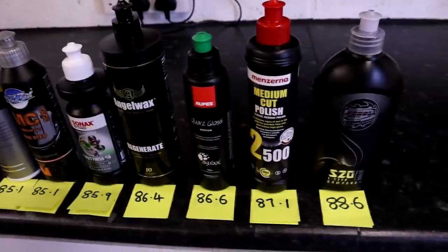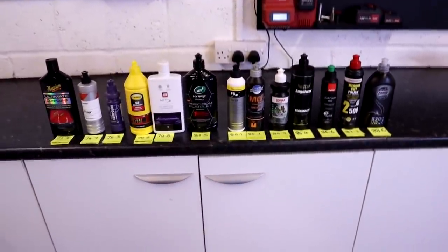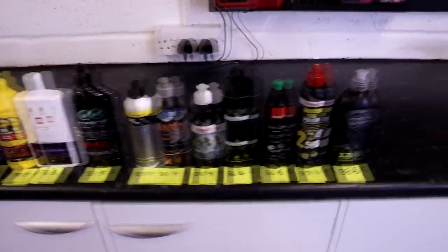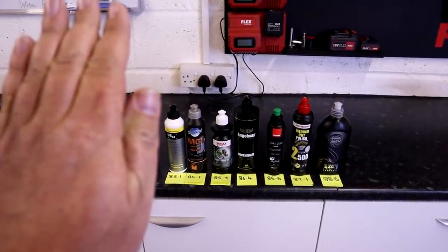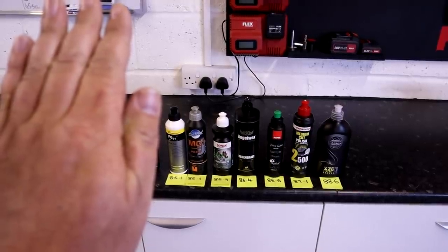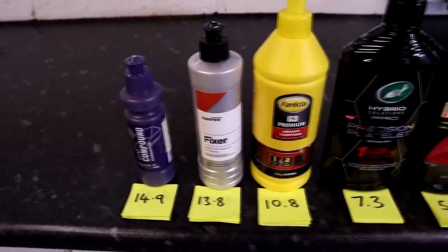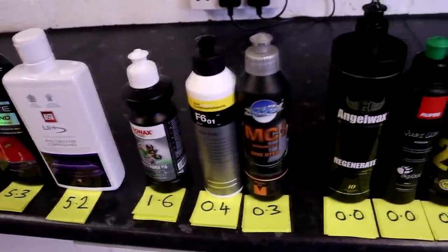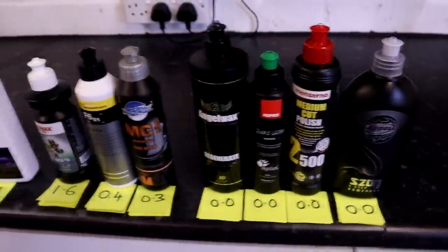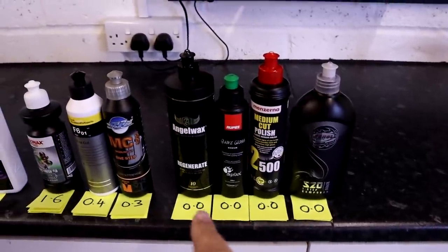Results can always vary, and it's important to say these products perform much better on harder OEM clear coat. Don't take this single test as an absolute indicator that one product is amazing and another is bad. If you want more conclusive data, you need to repeat tests across different scenarios and clear coats. The products on the right-hand side finished down really well and gave a good level of gloss. Using the GONEO photometer, we also recorded the level of haze each product left behind — a low reading is good, a high reading is not. Again, this is based on one test on soft non-OEM clear coat, and technique can significantly influence results.